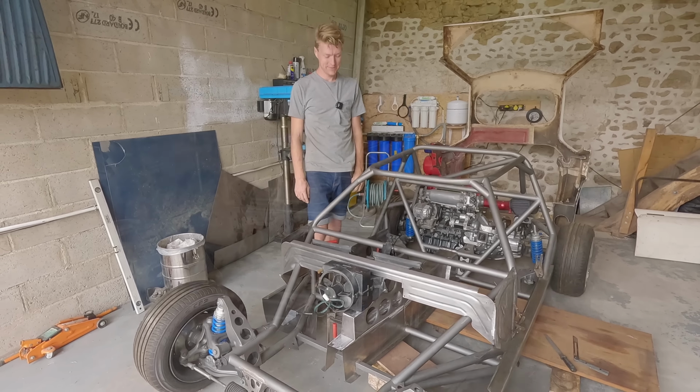So the way I've worked it out is we want a 30mm gap, so I've marked our centre line there to there, well, Dad did that, and then I've made these two 15mm from the centre line on each one. The outside radius is 52mm and the inside radiuses are 40mm.